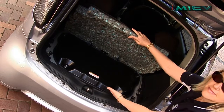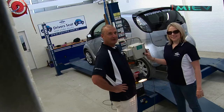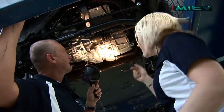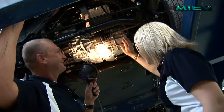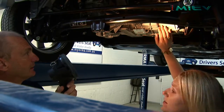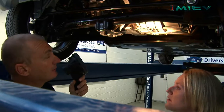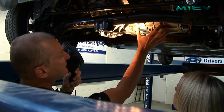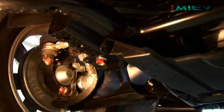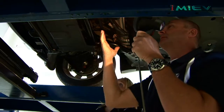There is your electric motor. What exactly is under the bonnet? Let's put it up in the air and see what's underneath. We're not allowed to take the cover off on top, so we've decided to come in underneath. And here it is — that's the electric motor, here's the battery pack. Most people think an electric motor has no power. How much does this actually have? It's got as much power as a one-litre petrol equivalent. Most small cars are front wheel drive, and you can see the drive shafts here coming out of the reduction gear.